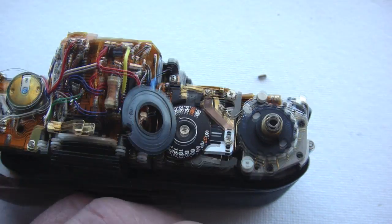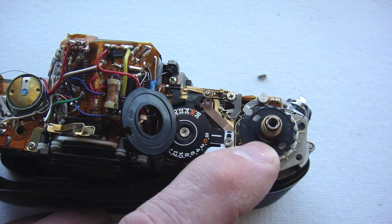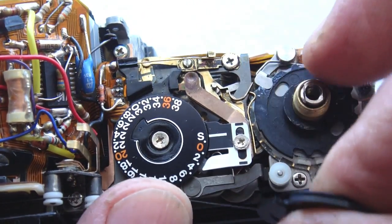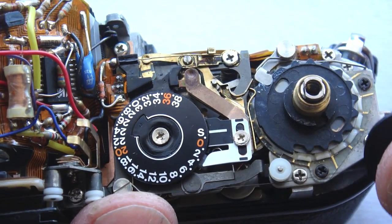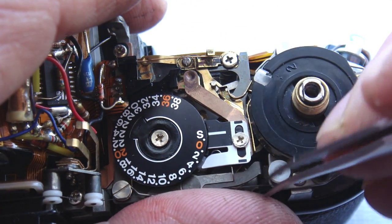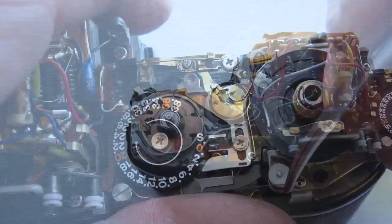Push the switch contacts aside for clearance. Don't forget to install the 3 wind plate screws. While retaining the tension on the meter link plate, route the tungsten wire around the pulleys and drop the plate into position. If needed, use tweezers to properly position the wire in the pulleys.